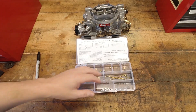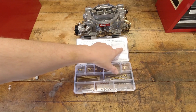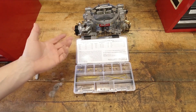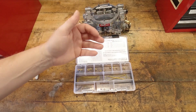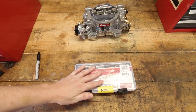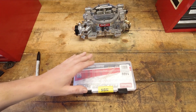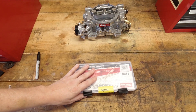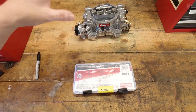Here's another little tip: if you don't have a vacuum gauge, they're fairly inexpensive. But if you don't have one, start with the heaviest spring — in this case the silver spring at 8 inches. Start with the heaviest one. If it cures the problem — the stumble, the off-idle little stumble — then drop down to the pink spring, which is the 7. Keep dropping down until you get back into the problem again, then go back up one. You should be good to go. Selecting the right spring is pretty critical because you're trying to get to a place where you can start to work with it, measure it, and start the tuning process. A good vacuum gauge isn't that expensive — I'll try to leave a link below to the one I use. But that's how you select the spring for your engine setup.